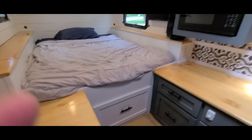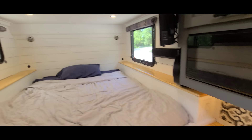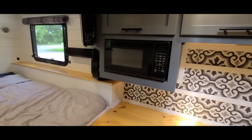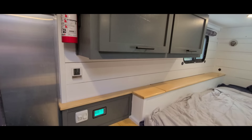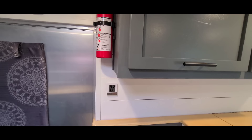For some people this might not be considered a budget, but the trailer alone was $4,800 and I put another $5,000 into materials, so close to $10,000 total. You can't touch a comparable brand-new camper for under $20,000. Plus I know it's built better than most RVs. One thing I didn't mention: it is insulated — two inches of foam in the ceiling and one inch on the walls. The frame is 1x2 tube steel — do your research and make sure you're not getting a cargo trailer with Z-channel framing, because that's an inferior product.